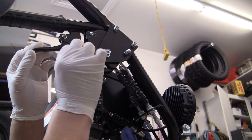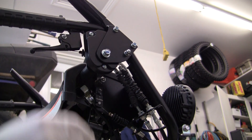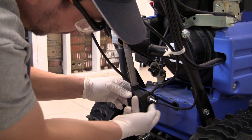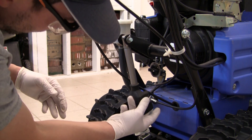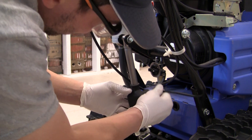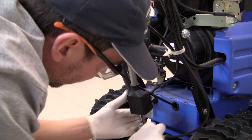What we'll do is actually get the cable to come out of the handle end and get the cable pulled out of the handle side. Fortunately there's just enough slack for that. Now that I've got that off, there's a nut behind this rubber that you want to undo completely — it's going to fall off the end of the threaded piece. Now I think it's off, so I can get the cable out from there and pull this whole thing out. There we go, I've got that out.